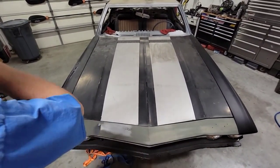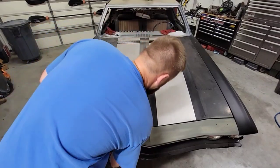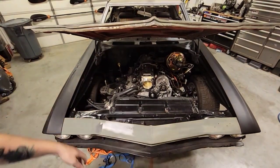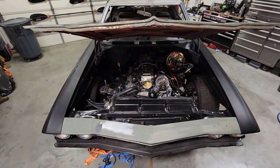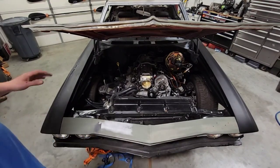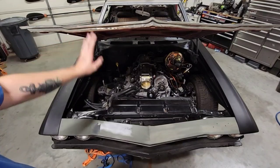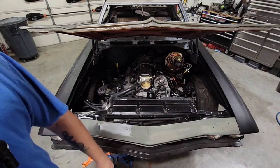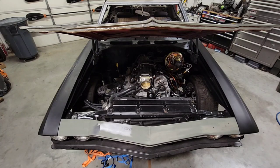That's pretty much what I had to do on my hood to get it to line up. Don't forget - check the core support, straighten it if everything's not going right. This car was completely apart, as you've been seeing, so who knows what's going on with this little guy. I'm sure I'll have to play with it some more. But there's a little left-right in the core support. Just kind of rotate your fenders as you need to, and tighten all those bolts. So, thanks for watching - that's going to kind of wrap up the hood alignment video for today.